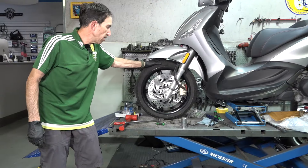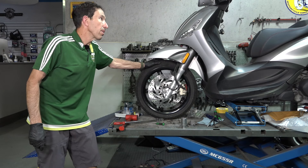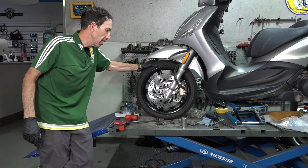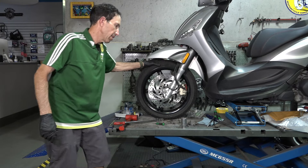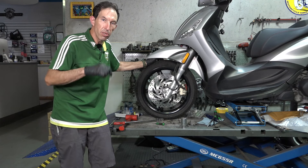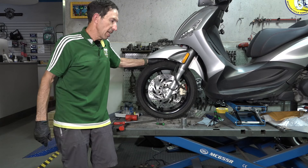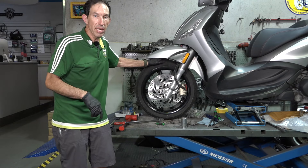And that's pretty much it. Make sure the tire is inflated to about 32 PSI. If it's a brand new tire, you want to look at my prior video on how to change the rear tire. The very last section is on how to calibrate the traction control or ASR system as it's referred to. So if you have a 2015 or later BV350, you're going to need to complete those steps if you replace one tire or two tires — definitely need to recalibrate the system. Thanks for watching. Robi here from Vespa Motorsport and ScooterWest.com. If you just stumbled across this video, check out the Vespa Motorsport YouTube channel and in the search there you can just type BV350. I have a lot of videos from the past on how to service this scooter — pretty much every service you could think of. If you're looking for parts, accessories, service items, or tires, check out our web store, ScooterWest.com. We'll see you on the next one.